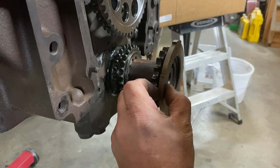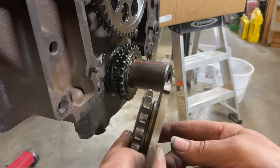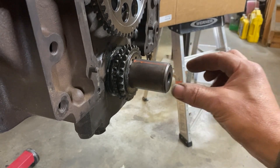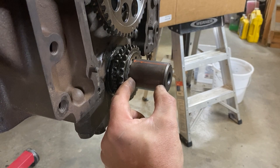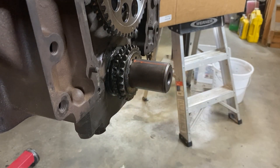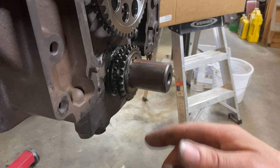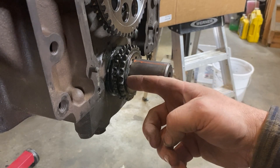So if you want to make sure your belts all line up, your new setup needs to be the same thickness as this so that when you tighten the balancer all the way up and it comes and touches this gear, you have the same distance - therefore your balancer sticks out exactly where it was before. So I measured this. The old gear sat in there exactly 2.014 inches - 2 inches and 14 thousandths is exactly where that sat.